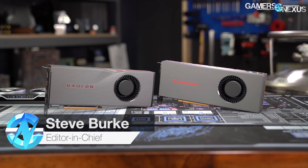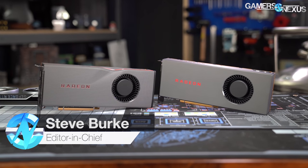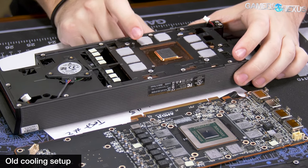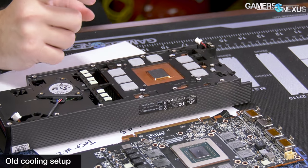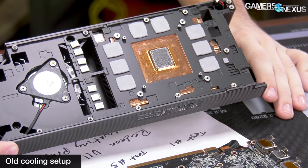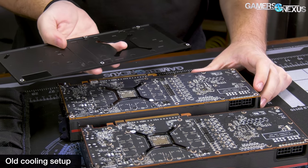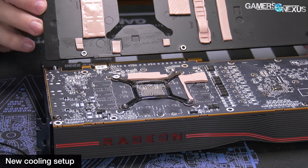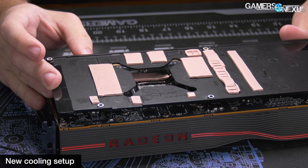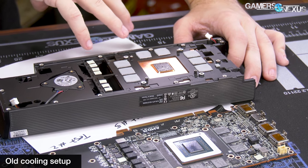Our initial benchmarking of the AMD RX 5700 XT GPU had one primary complaint, and that was predictably the blower cooler. We typically do hybrid mods where we stick a liquid cooler on a GPU to improve it, but this time we decided to do something simpler and replace the Hitachi HM03 thermal pad with four cents worth of washers and some thermal paste. Then we made an additional change after that and added some thermal pads to the backplate for some A-B testing. This data shows how much of an improvement you can get with better mounting pressure on the GPU and with some new thermal paste rather than the thicker and more thermally inefficient thermal pad.